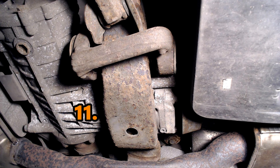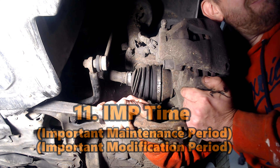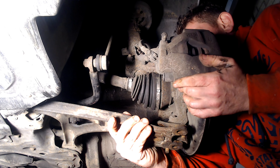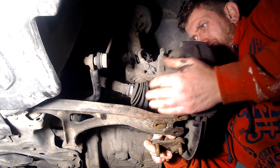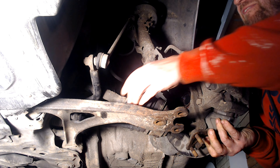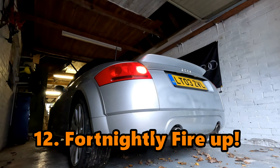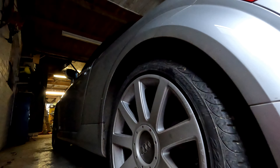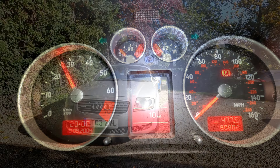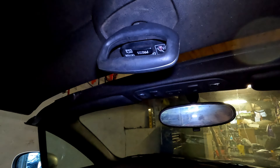I also class winter as the IMP time in my world. IMP stands for Important Maintenance Period — or for those of you that love an upgrade, the Important Modification Period. The car will be off the road for a while, so this is a great opportunity to undertake those jobs that need more time: overhauling the suspension, stripping components that need rust protection, or major engine bay work. Every two weeks or monthly if you prefer, I recommend rolling the car out, firing it up and leaving it run until you get it up to temperature — a good 5 to 10 minutes. This will allow the various fluids to pump around and flow. Give it some revs to blow the exhaust through, give the brakes a good pump to ensure they are working. Try to choose a sunny day so you do not undo your hard work keeping it dry, then repeat the steps to store once more.